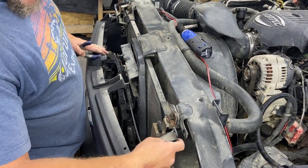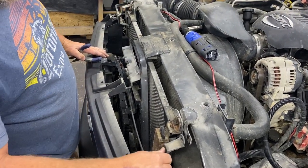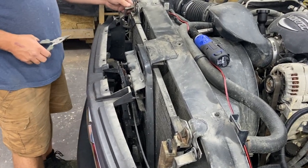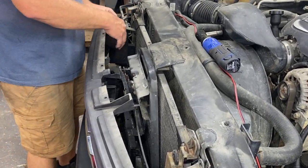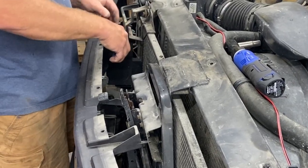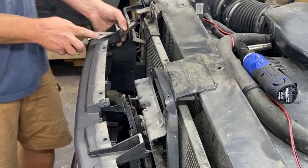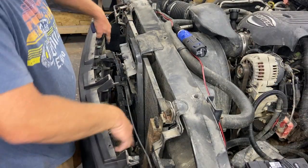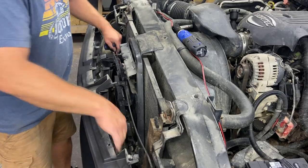So I had some 10 millimeters here to hold this plastic support structure in — one 10 millimeter here for the grille, same over here for the support structure. Now I can pull this out. These are just pinched to fit right here, and if you wanted to you could use a Phillips and turn these out but it'll leave half the clip in there. And down here we've got a couple more of those at the bottom and this will be free.